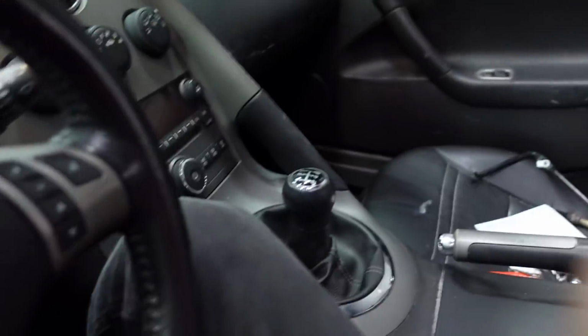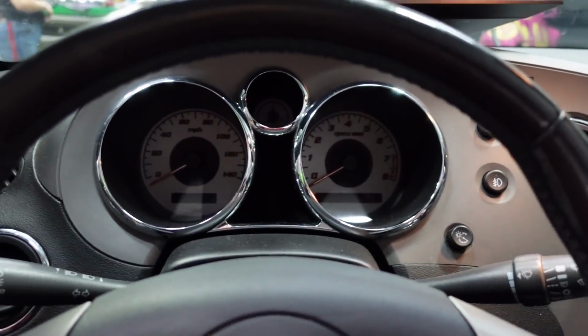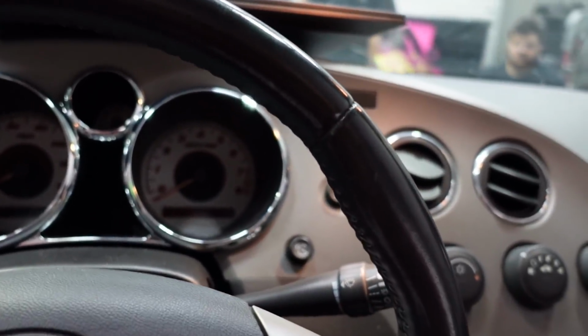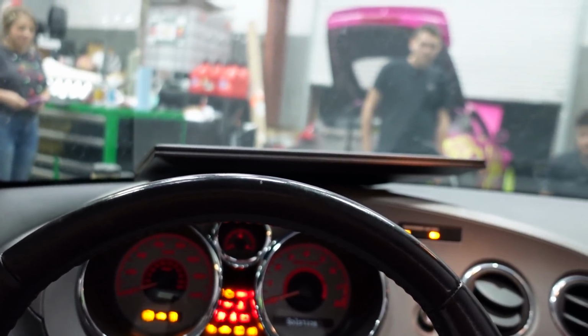That's a good track. So the mistake I made is actually pretty easy to do. If you are by chance putting the same pump that we put in this car, it's important to note that even though the plug just swaps out like it's a direct plug and play, it actually switches polarity. So the positive is where the ground would be. So I basically had the pump plugged in backwards, and although it dribbled out, it really didn't have any fuel pressure. That's why it didn't start. So now we're gonna see if it starts. Okay, now I hear fuel pressure.